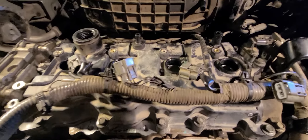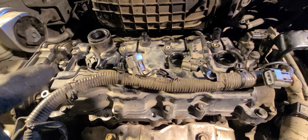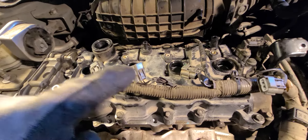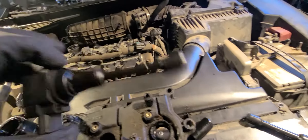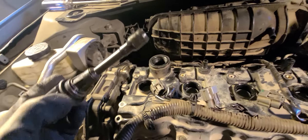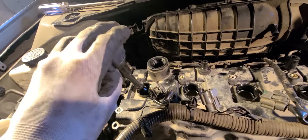What I did was I went and found a nice clean one, a good used one off of another engine. This one wasn't leaking at all — the tubes were nice and dry in there. How I found out was I went to pull out one of the coil packs. I was replacing the spark plugs, pulled it out, and it was full of oil — like lots. That tube was pretty much full.